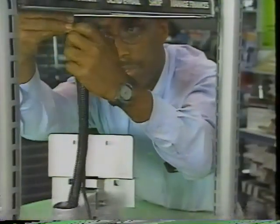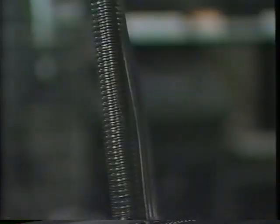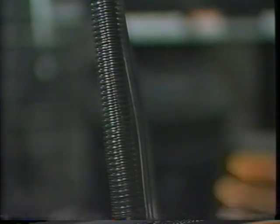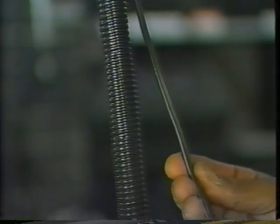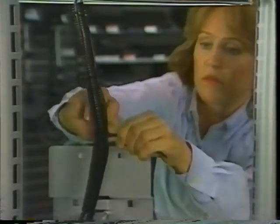And now for the final details. Use split loom tubing around the speaker system's audio and power wire. Don't put it around this black high-voltage 3-conductor AC wire, which is for the lights. It should be left separate to maintain UL standards. Instead, wire tie it to the outside of your split loom covered wire bundle.